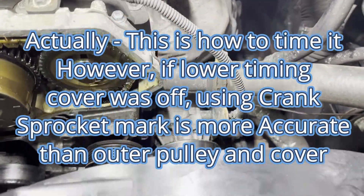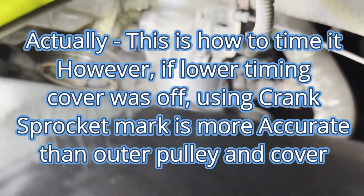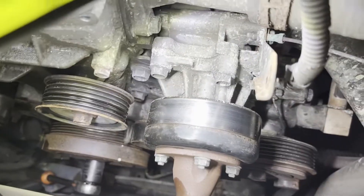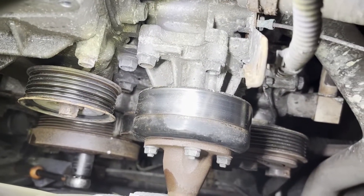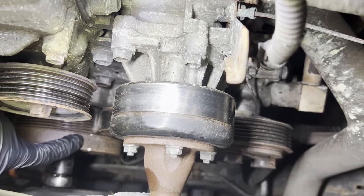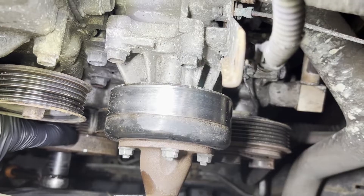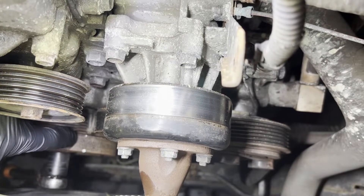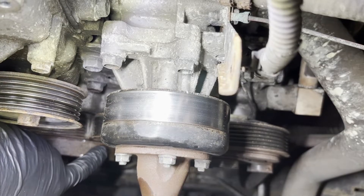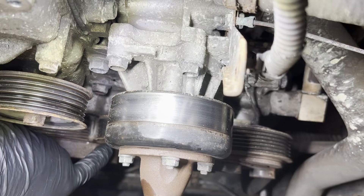It's not very clear in some of the Nissan manuals, but you will see down below the crankshaft pulley has three marks on it. I highlighted the one mark using some whiteout. The surface here on the forward portion of the crank pulley actually has divots cut in it where you could put your fingernail and get caught in there or a small screwdriver. There's two marks ahead of the timing mark that you need to use. There's two marks very close together here.